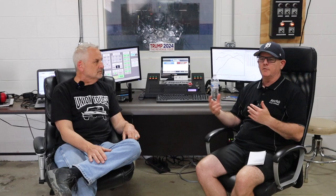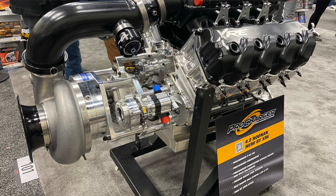The dyno is good for checking cam timing, trying different headers, assessing fundamental changes in camshafts, intake manifolds, and headers — looking at relative differences in output. To do a true vehicle calibration, it's not the way to do it. On more modern cars, for cold air intakes or exhaust installs, a before-and-after on a chassis dyno makes sense. For forced induction on a newer car, you put the new tune in and validate you're not going to have knock.